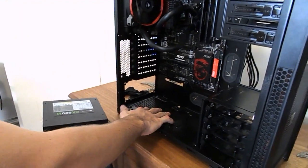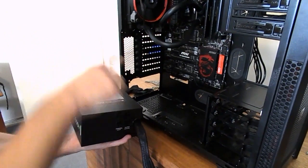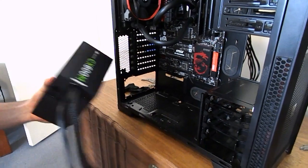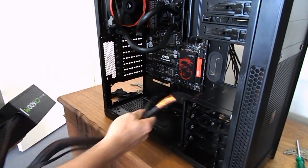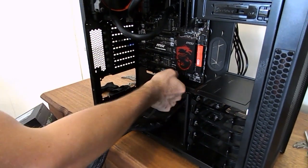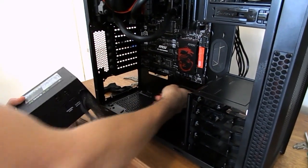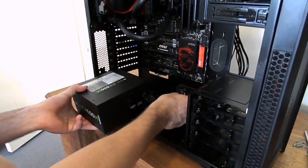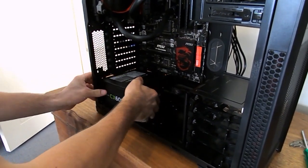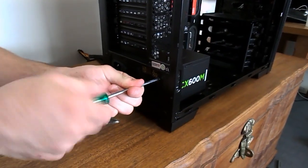The only situation with that, guys, is if you have your computer on the ground and there is carpet, it won't be getting much air. It might suffocate a bit if it's under a big load. We are going to mount it that way because we know elevating your computer is always nice, and a hard surface is good. Also, we want to keep slightly positive air pressure inside our case. You want your airflow to go through the front of the case or the bottom and run up through to the back and the top, because obviously hot air rises. It's a lot easier to make air go that way.